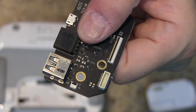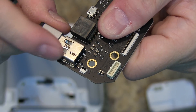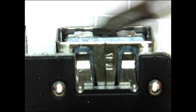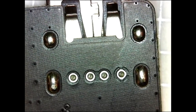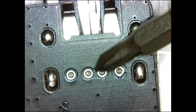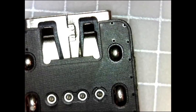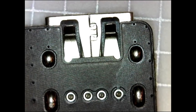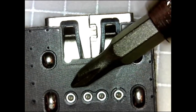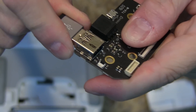The problem arises when you want to hook up your tablet to your controller and it may not be making a proper connection because of these solders right here. This is the USB female end that you join up with your tablet, and just under that is where it is soldered to the board. You can see that these are machine soldered and as a result this can be loose — these aren't making contact with the board. So if you're having a glitching problem where you can't see your app or it comes in and goes out, this right here is more than likely the culprit. Also your USB could be a little bit loose and that could be what's causing intermittent app problems.